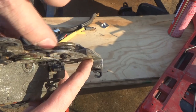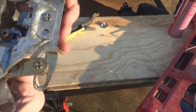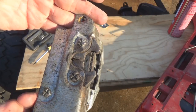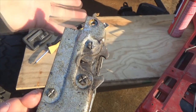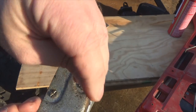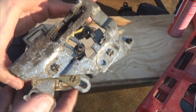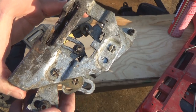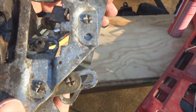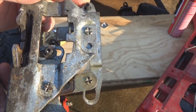So I took some brake cleaner, shot it in between here and inside here, and now look - it works as smooth as it can be. What a person should do now is get some more brake cleaner, spray this thing down real good, get all that sticky goo off of it, clean it up, lubricate it, and put it back in. I mean, I got this working - we're good to go. So I'm going to put it back in the door and show you guys how to reassemble it.